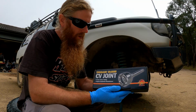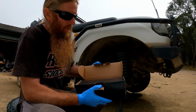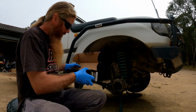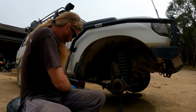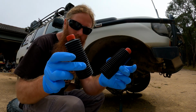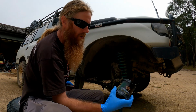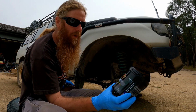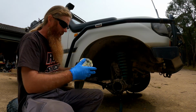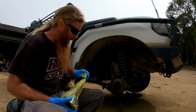Time to put in the new CV. So we're doing a Terrain Tamer CV, not sponsored by them, just like the quality of their gear. Seems like a reputable, trustworthy brand. Now they give me a couple of these grease to pack in the CV, and then I've got another tub of grease with the Penrite, not for any particular reason other than I like Penrite, and we'll use the Penrite grease to pack the rest of the knuckle.